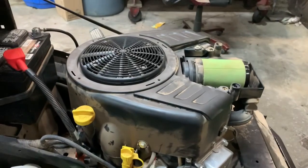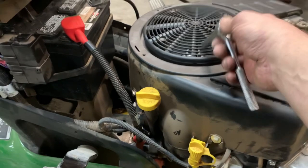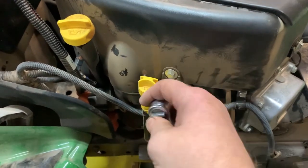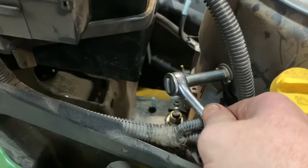I blew out that main jet and it didn't do a thing. It's actually running, but it's surging badly, so we're going to have to go through the carburetor. I'll show you what you need to clean on these little Nikki carburetors — they're a pain and sometimes will not take a cleaning and you just have to replace them. But this carburetor being fairly new with only a fuel blockage, let's dig into it. To remove the carburetor on this V-twin Briggs we're going to have to take the blower shroud off and take the chopper screen off — just screws around here. You don't have to take them all the way out because the blower shroud is notched, so just loosen them up.